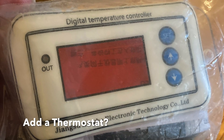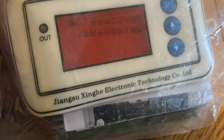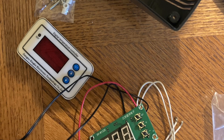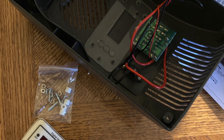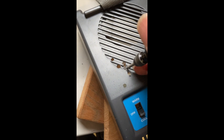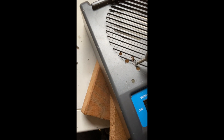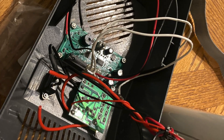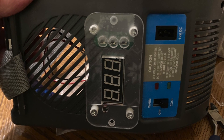What about adding a thermostat? I got this one off Amazon for $8.99 because I didn't want to pay five dollars more for the Fahrenheit version, and then tried to see if I could install it into the fridge. So a little Dremel tooling here to get the plastic case opened up so I could fit this in there, and then mounted it inside — it clears the other electrical components inside.